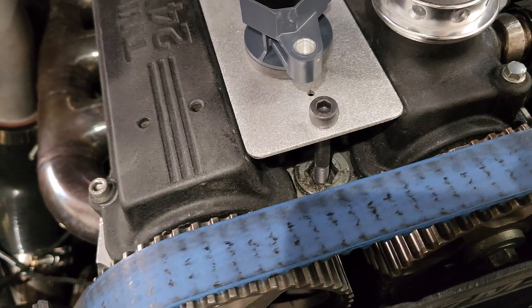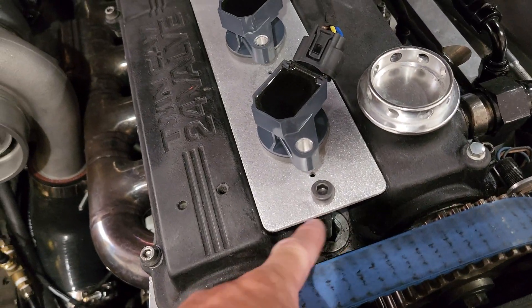We don't want to put a bolt through the back because there's a ton going on back there with that coolant hose — it'd be a nightmare. So you'll need to pop that plug out and just swap it with one of the other three; they're all the same thread pitch. The bolt goes right in there with no problems. There's also going to be a standoff here, a little aluminum sleeve, to make it look nicer. One other idea we're throwing around is the same exact plate with no holes in it — just a flat plate — for guys running like the IS300 coils. It'll sit over the top of everything and make it look almost like a 1J or a 2J, covering up all the stuff on top and sitting flush with the valve covers.